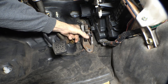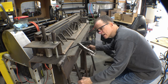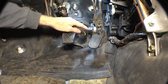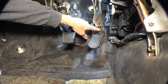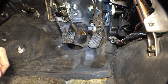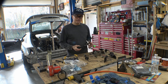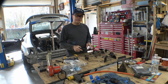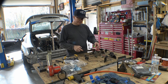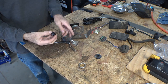That looks pretty good — just a little adjustment to make it fit. To get the original positioning of the pedal, I put it all in place, clamped it with a pair of vise grips, and just put a couple little tiny spot welds on it, pulled it out, and then welded it. Nothing to do now but assemble it and put it in and see if it actually works. I kind of left you out on the 14 times that I put it in and took it back out to get this welded in position — but you didn't need to see all of that anyway.